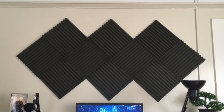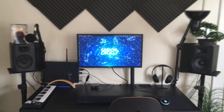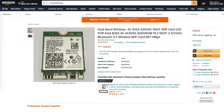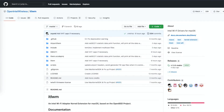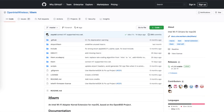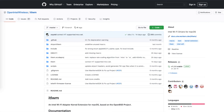The guide calls for a different Wi-Fi Bluetooth card, but as I mentioned I went with the Intel AC Wi-Fi Bluetooth card, so you need specific kexts to get the Intel card working. I've included links in the description to these kexts and guides — if you follow them you should be able to get your Intel Wi-Fi up and running with your EliteBook in no time.